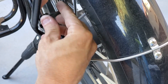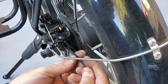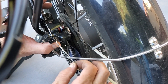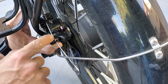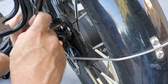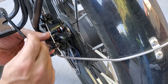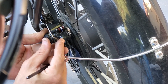Putting these bolts back in. I want a little bit of play side to side for right now. I'm going to take the brake caliper arm and slide it back up the cable, pulling down on the cable, looking for where it was pinched earlier, and tighten that back down. I can see these two legs on the outside were hitting the center leg, so I'll line that up.